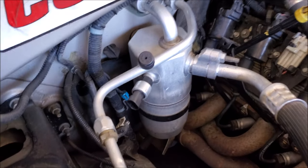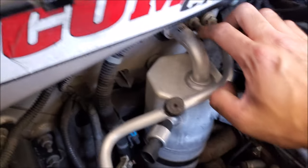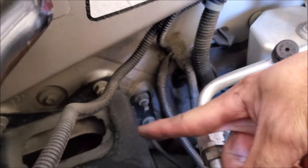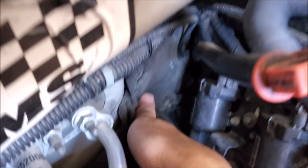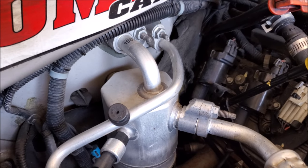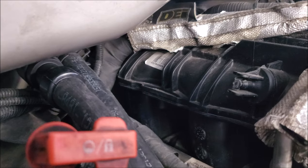You're not done yet — now you have to go under the hood. I already had the AC system depleted because you have to remove the fasteners here to get this disconnected, due to the evaporator inside. You can also access the fastener here, the fastener there, another one down low in here, and then another fastener over there. All of those have to come out in order for you to remove the box that holds the blower motor, the heater core, and the evaporator. To remove the quick disconnects you will need a special tool to remove them off of the firewall.